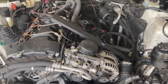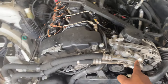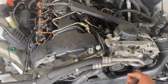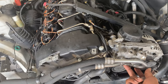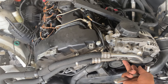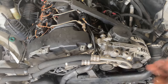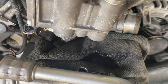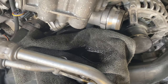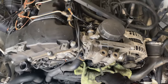Now ready to go underneath the car. I noticed I forgot one thing — the oil cooler wasn't disconnected. You can disconnect from either end, but I'll disconnect it at this point right here with a 13 millimeter, loosen and pull it off to the side. This is one of the easier spots to remove it. I'm going to get a rag and put it there because some oil might drip down — it's been leaking before from the drain plug beneath. I caught all the oil with the rag so it didn't hit the floor. This whole part right here is situated with this oil cooling line.